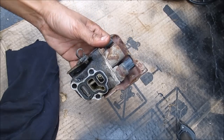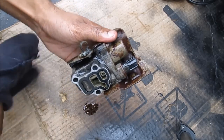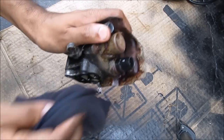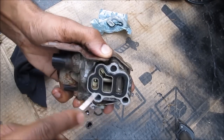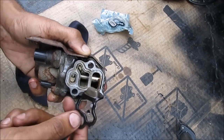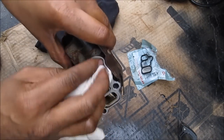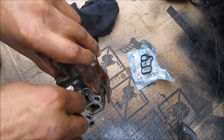I'm going to use a little bit of brake cleaner and a rag to clean up this solenoid and wipe away all of the oil residue. I'm just going to use a little screwdriver here to pry up on the gasket. The old gasket is all dried out — there it is. Now I'm going to take my brake cleaner and clean the mating surfaces with a clean rag. Make sure it's nice and clean — you don't want any contaminants on the gasket surface.